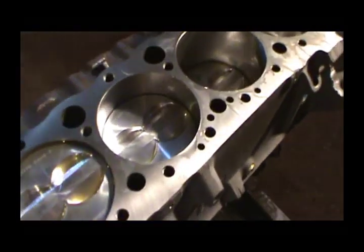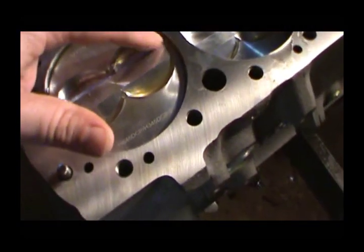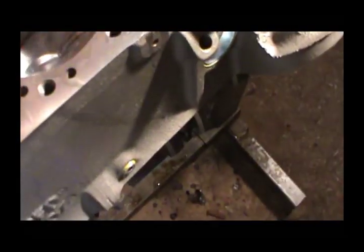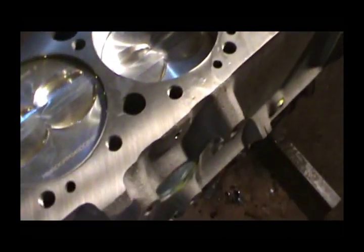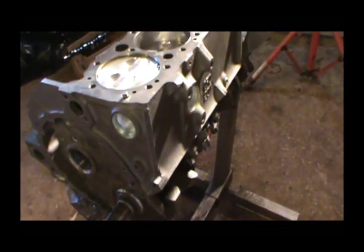All right, we've got them all in. One thing I failed to mention earlier: you want to make sure these cylinder walls are really well lubricated. I went back and poured oil around them. On the ones I hadn't put anything on yet, I just took oil, put it in my hand, and wiped the walls good. You can see it's all over the head and block — it'll have to be cleaned off, but I want to make sure you've got plenty of oil on these cylinders because we're going to be moving these pistons up and down. We'll be moving them now to torque the rod bolts — that'll be next.